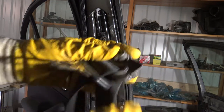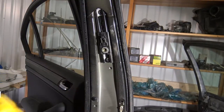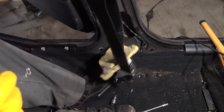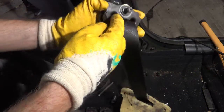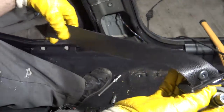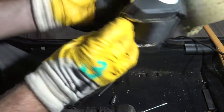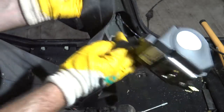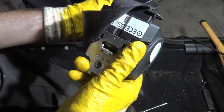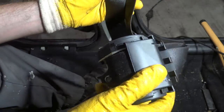There is this upper bolt which we have to install in the same way. Now we can see that this seat belt loops in here — it is free. I can install this new seat belt in the same way back. If we have a worn-out seat belt we can install a new seat belt this way. Here is the new seat belt — okay, thank you my friend.